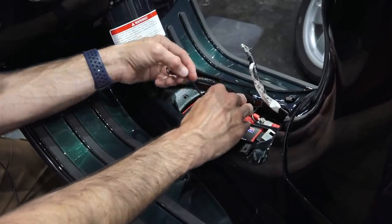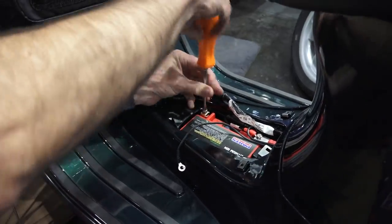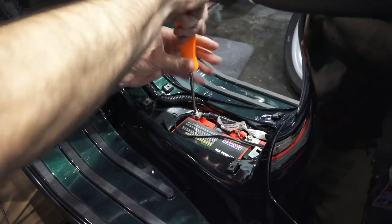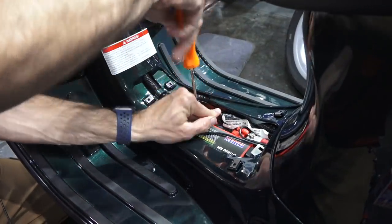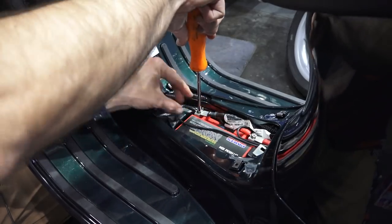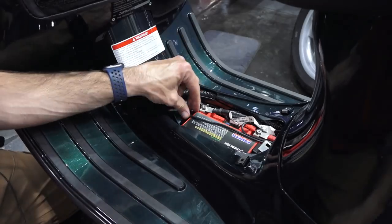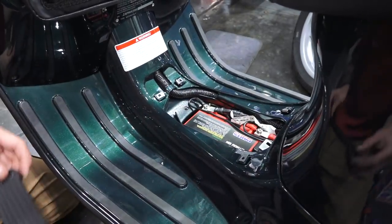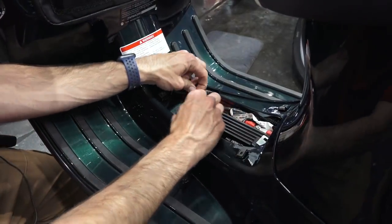Sometimes you'll have a little spark — that's just the capacitors charging up inside the computers and electronic parts of the scooter. Make sure the terminal is nice and tight. Put your battery strap on — sometimes you've got to snake it around, making sure you don't pinch any of the wires.